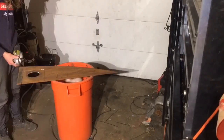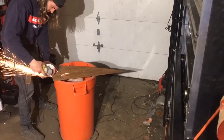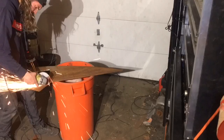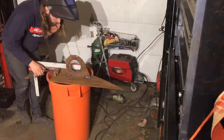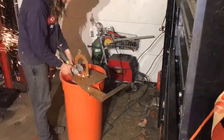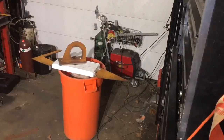Now I'm going to cut it out just like that to make the faceplate. We're going to do a little time lapse — chop chop chop. There you go, and do a little more chopping, a little side cut. This is going to be where the motor mounts up to. And right after this I'm going to cut the base — actually we're going to weld it first, because the metal flexes when you weld. I figured why not do it while it's reinforced. So now we cut it out — bam, we got the motor mount. Look at that, perfect.